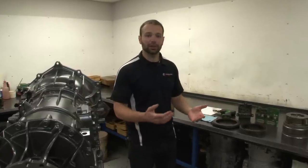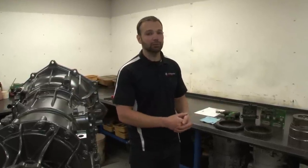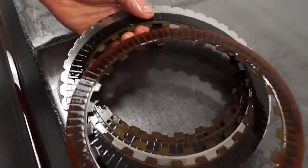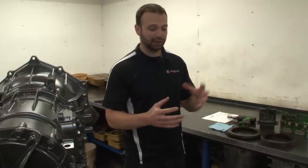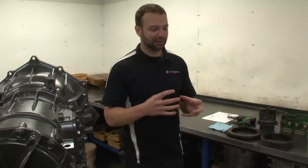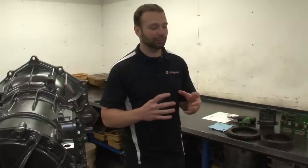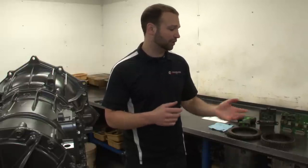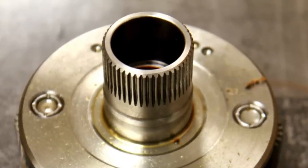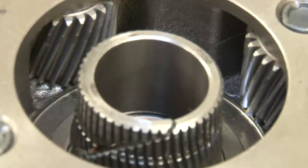Not too scary, but just so you know — if you take the truck out on a high horsepower tune before it gets a chance to learn, there's definitely some downside to that. Best case scenario, you get a little extra clutch wear and the thing just shifts hard for a little while. Worst case scenario, you can get a tie-up — and what a tie-up is, is where one clutch is applied while the other has not fully released, so for a moment both clutches are applied. That stresses the hard parts to the point of twisting, and it's a really bad situation. We'll show you some pictures of twisted P2s — common stuff we find on trucks that are run hard without a relearn.